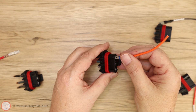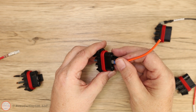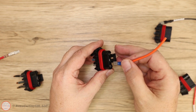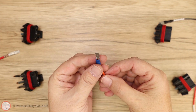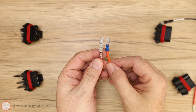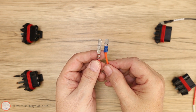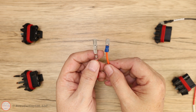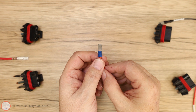Again, no resistance — no real resistance at all as far as inserting and removing it. Resistance in, resistance out on the good ones. So this is a reasonable equivalent to the OEM connector to replicate that size of male spade connector that would be used from the OEM fan side to connect into the OEM harness connector on the vehicle side.